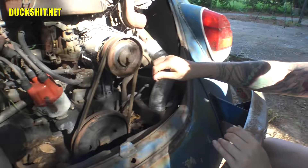Up above you've got your mirror and your sun visors. Get a good look at the headliner — this headliner is obviously toast, so that's going to have to come out and get replaced. Check out the door panels — see if you've got your handles, your knobs, window cranks, all that stuff. See how intact they are. Check your little vent window knobs — see if you can move them and if your vent window will open. In this case it's pretty sticky — don't force it. Also check to make sure the lever here works — looks like it's also sticky. There should be a door handle, a door pocket only on the driver's side typically, but there is one on the passenger side over there. Check your window crank — see if it will roll that window down. In this case it works, but it stops at a certain point. Don't force it — you might break this or the mechanism. Often all they need is some lube.